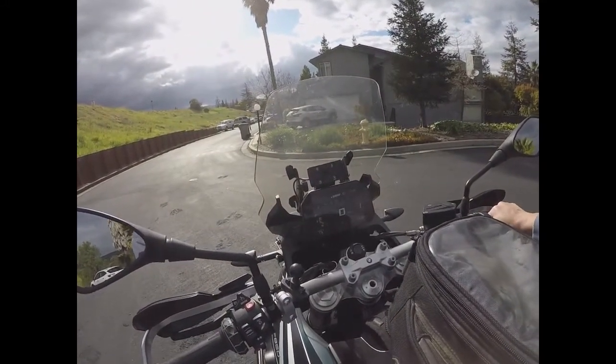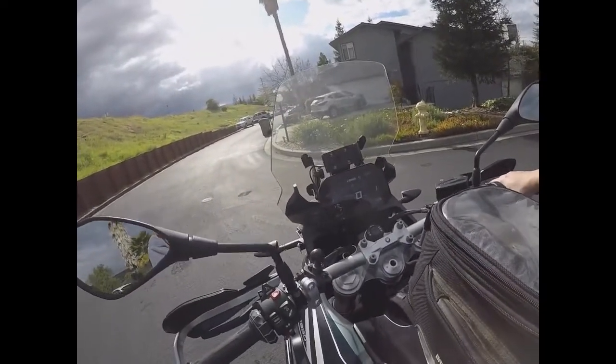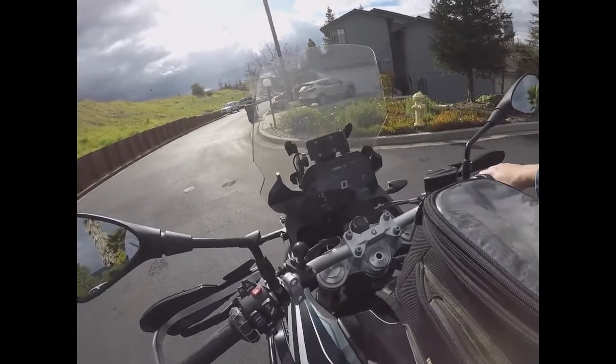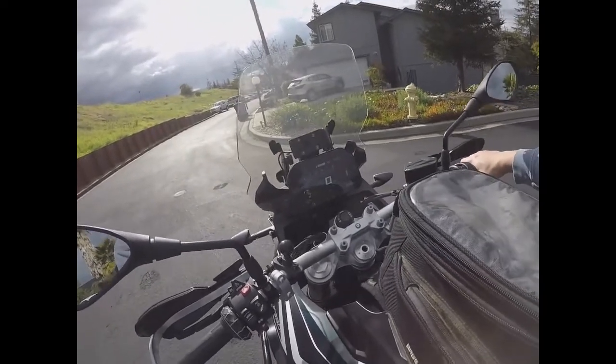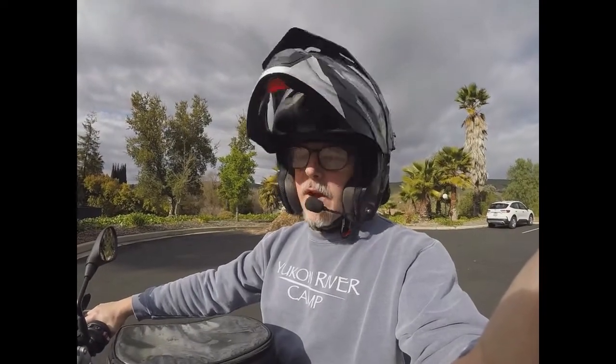And then if I start to roll on, I get it taken off. But right now it's just wanting to, I can hold it back with my feet, and that's what the internet says anyway. And in the troubleshooting for the Rekluse, it also mentions that same notion, that adjusting it should get you to a place where it's just tugging on you at idle, and not much more than that. And so I think we're there, and so we'll see how it goes.